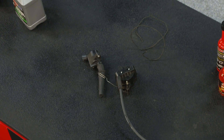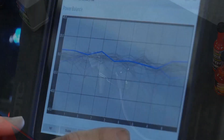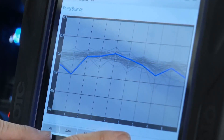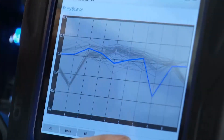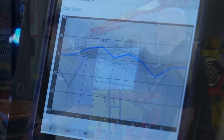Now, if you have a coil pack, you could just unplug it — super easy, one for each cylinder. Now, if you had a scan tool, you can do a fancy test like this. We ran a power balance test, and what's happening here is I just disable the cylinder. You see it dropping out there on number one, and then I put it back — it goes away. Now, interesting on this one: if you look over there on number four, you see it's dropping out. It keeps dropping out. So we actually had a misfire on cylinder number four.